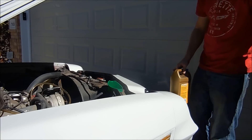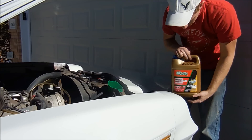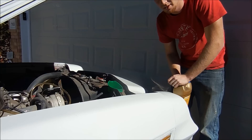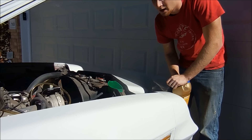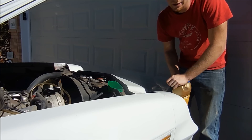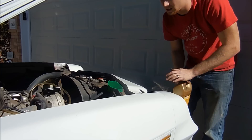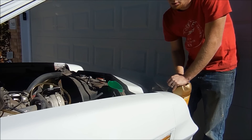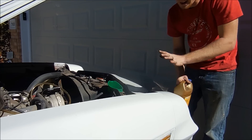When I got the car, it was low on coolant — that's fairly normal. What I'm going to do is fill it up with used coolant. You might be asking why I'm putting used coolant in. Here's why: if there's any kind of leak or problem with the cooling system, I don't want to put brand new coolant all over the driveway. So I save the coolant that I drain out of cars when I do radiator flushes, and use it on cars like this that I'm not sure about. If I find out the cooling system is good and holds pressure, I'll drain it and put brand new coolant in. These are $10 a bottle, so in other words — free.